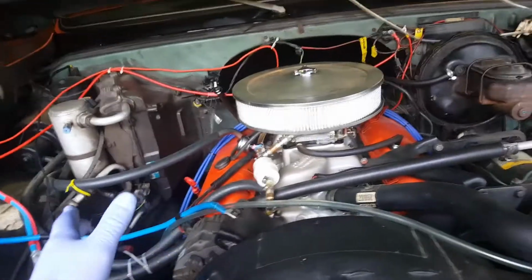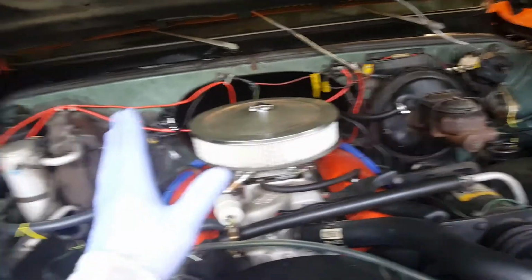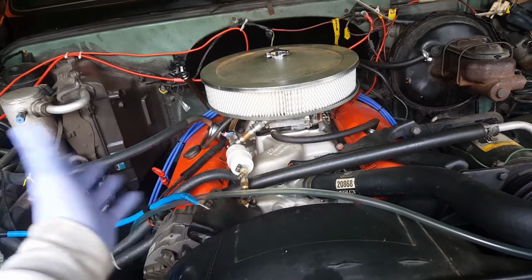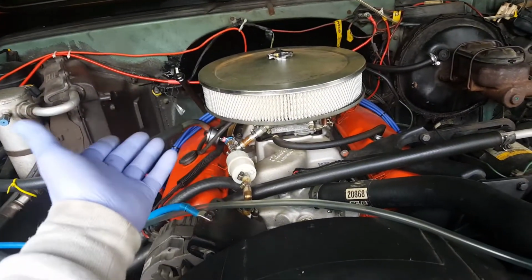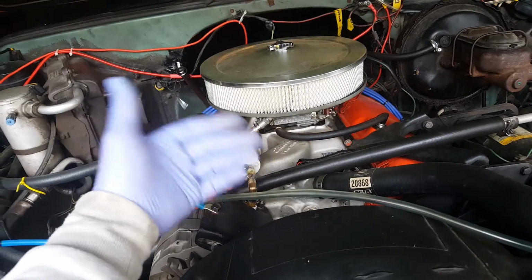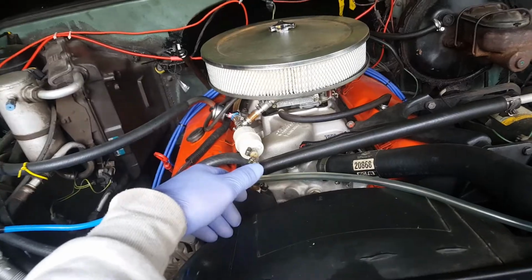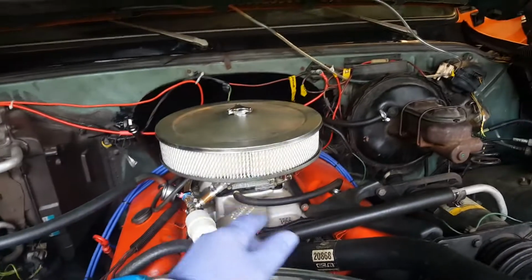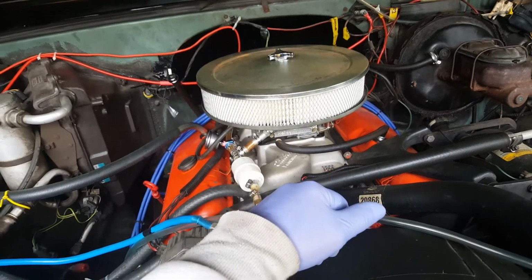Oh, just one extra thing, with this fuel pressure problem, the right-hand side tank did not have to be removed or the fuel lines inspected, so that was all good. I knew that previously because I could blow into the tank and I could hear bubbles. I think it was the same with the vent line going into the tank, but the tank was all good, and for that matter the sending unit was also good. We know that because we could see the fuel gauge, so that's all working after more than 40 years.